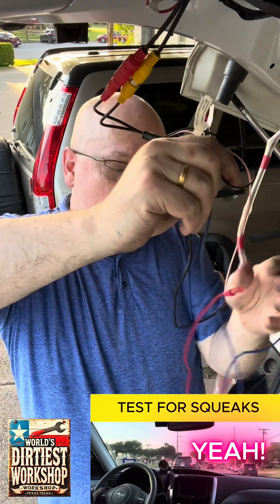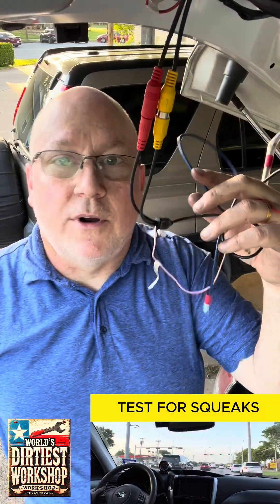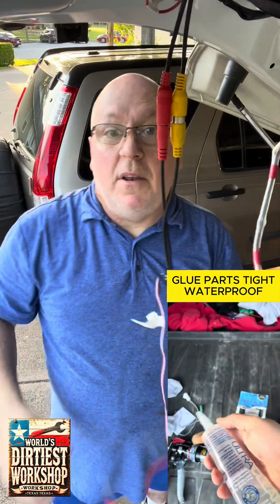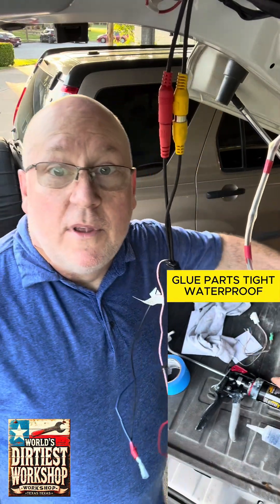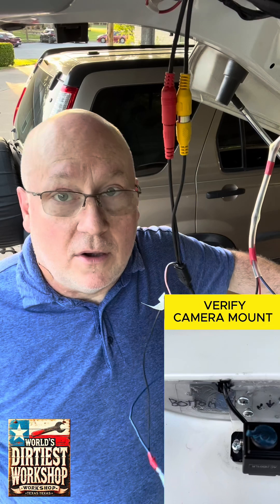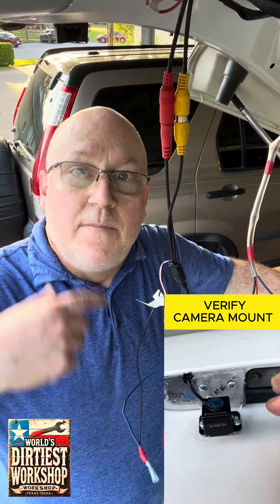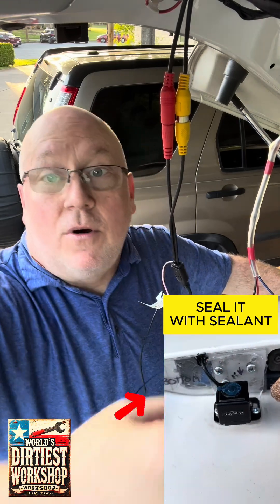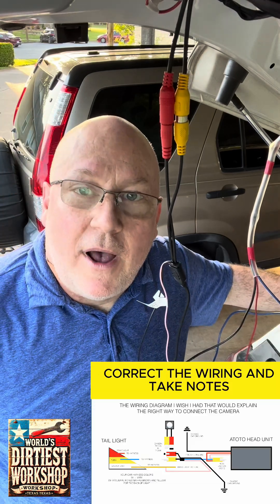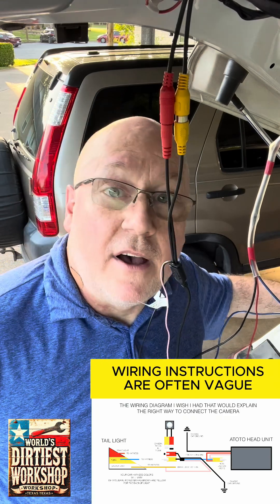Why do I have so much wire here? It's so I can loop it up and then tape it to the door. I knew going in that I was going to have about a foot of extra wire here. Make sure you have about a foot of extra wire when you're doing your cutting, because you never know when you're going to cut something and realize you didn't want that — now you've got to fix it. Maybe it's behind a seal or twisted around another wire and you can't put it back together. Give yourself plenty of room, because you can't uncut stuff.